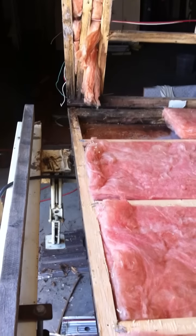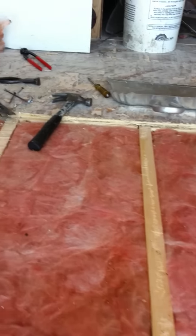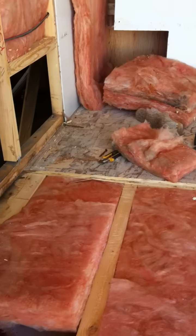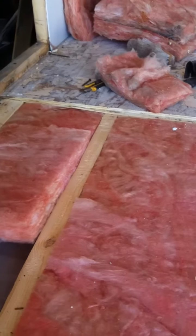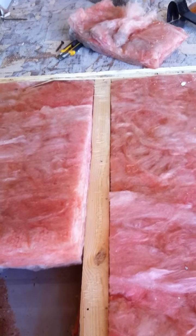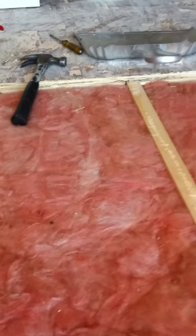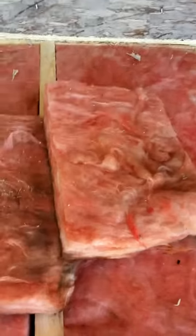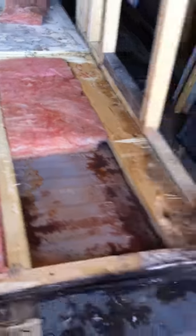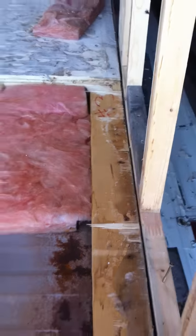The back piece of wood is almost in really good shape. I'd like to talk about the design of the floor. What we have here is two-by-two pieces running lengthwise along the trailer — it actually disappears under that sheet of plywood over there — and about every 16 inches we have one of those. Then on the corners we have a piece of two-by-four running the length of the trailer.